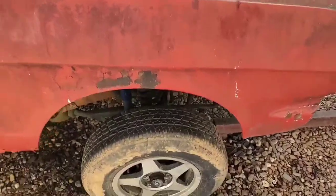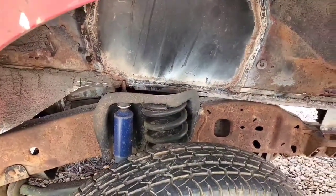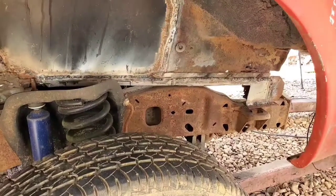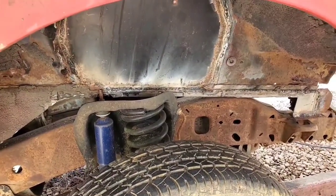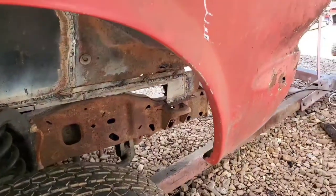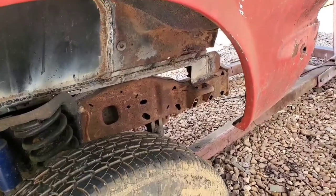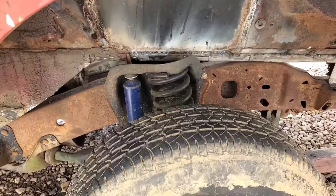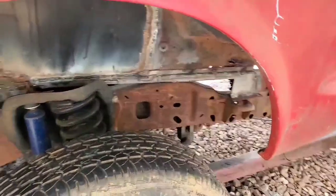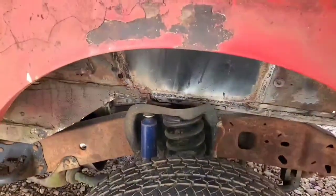All right, we pretty much hacked out about everything we can from the subframe before we actually would have started cutting into the top portion. I thought about it and figured that it's probably not a good idea to continue cutting into that, because all structural integrity would be gone. Number two, at that point where that tab is on both sides, we wouldn't have a good solid spot to attach any kind of body anchor. That would mean having to weld up some type of tubular frame to be a load bearing point to attach to that little mount on both sides. And then of course there's just the idea of pretty much killing the structural integrity of the whole front end. So we're gonna roll with it right here.